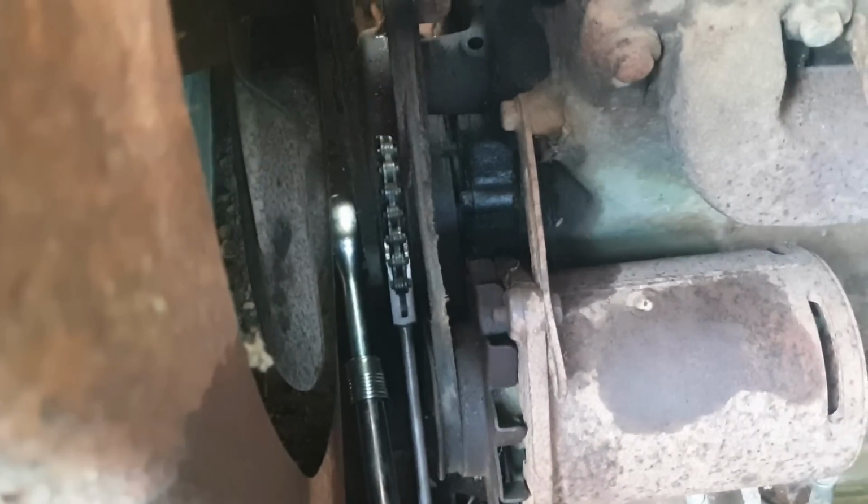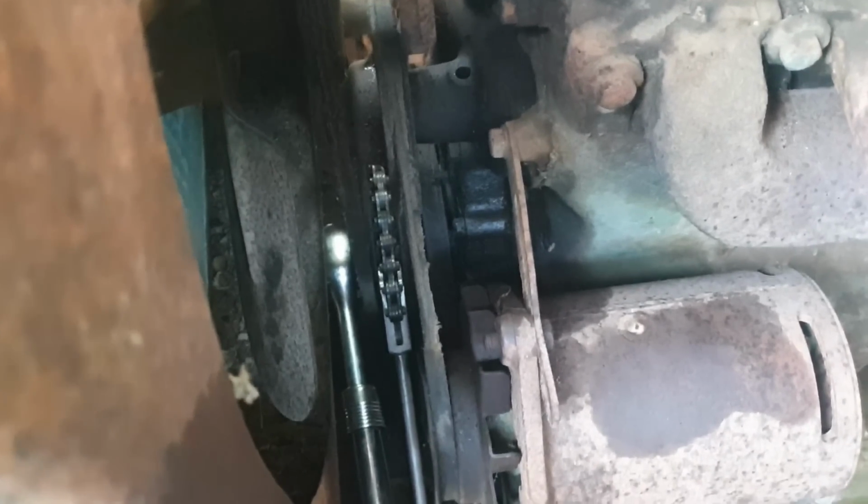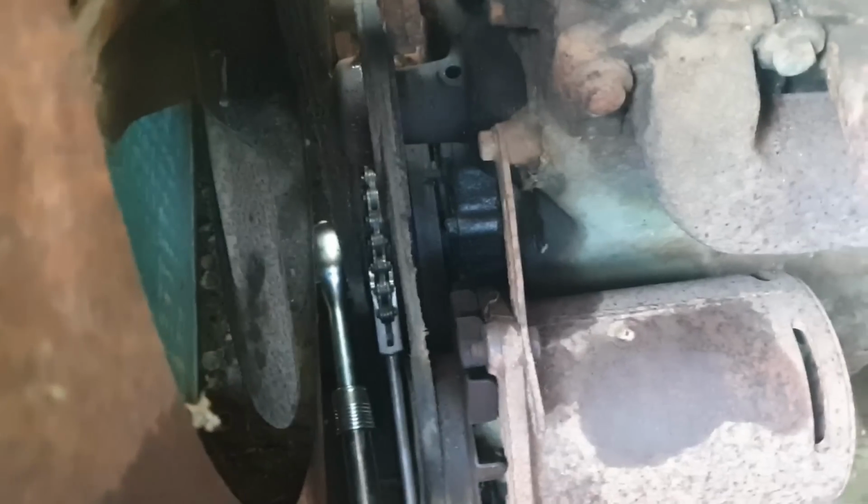That is an oil filter wrench, a chain oil filter wrench for when things just will not come apart, wrapped around the crank pulley, and an extendable ratchet with a socket on the front harmonic balancer bolt. Motor will move. Reach down here and grab it.